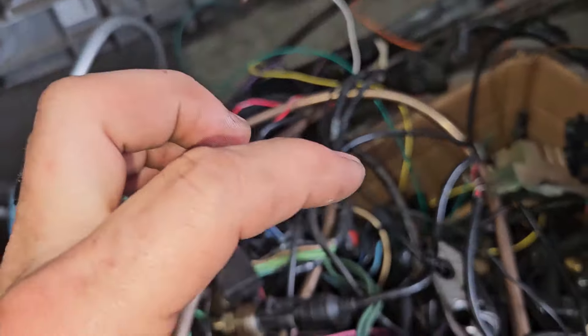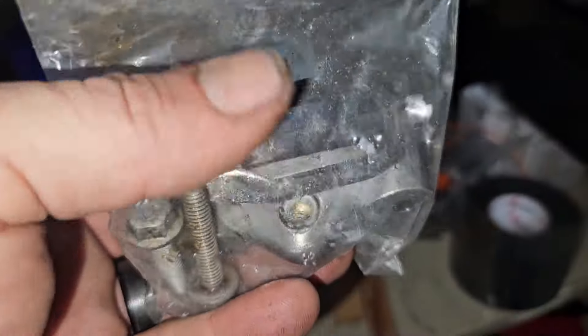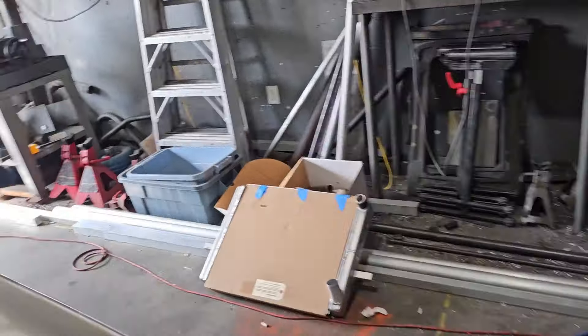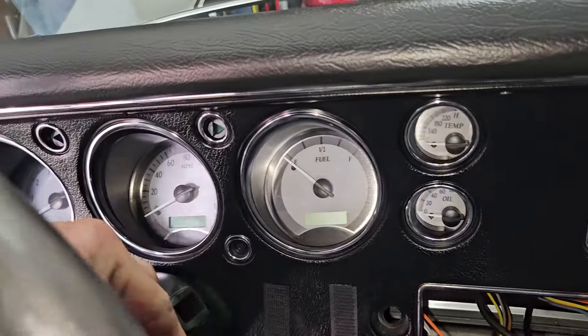His water temp is out — you can see it was getting all gooed up. The oil pressure sender had a bracket on the transmission that I took off. There was also a cap on the side of the LS oil pan — everybody drills and taps an 1/8-inch NPT there, but the plug I started with was coming all the way through and never going to bottom out, which is not good. I grabbed one off another oil pan and that's all sorted.